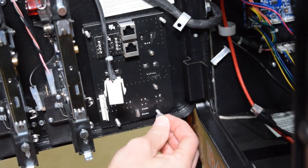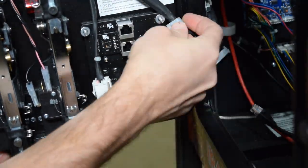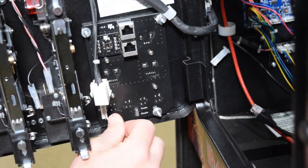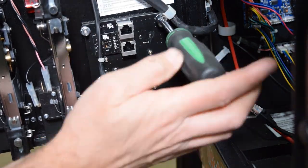We will be reusing the nuts but you can remove the spacers as they are no longer needed. Install the Pinwolfer CDU as seen here. Add one washer on each post, reinstall the wire loom for the upper right threaded post, and then install the nuts you previously removed. Be very gentle when tightening the nuts and do not over tighten them.